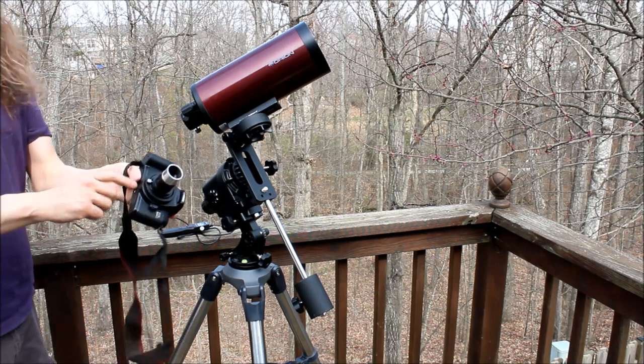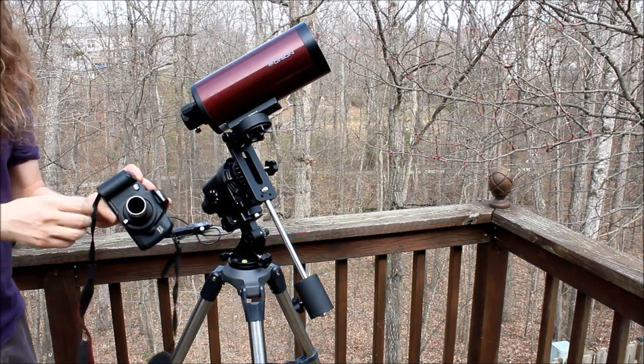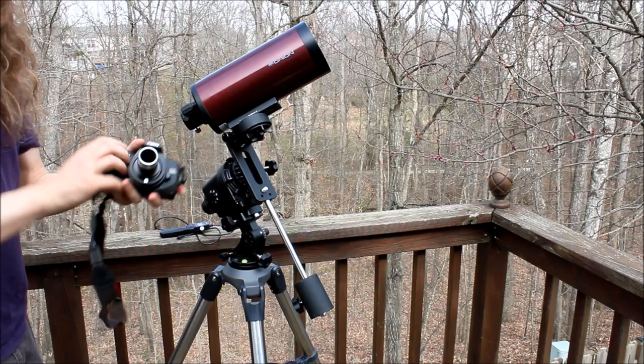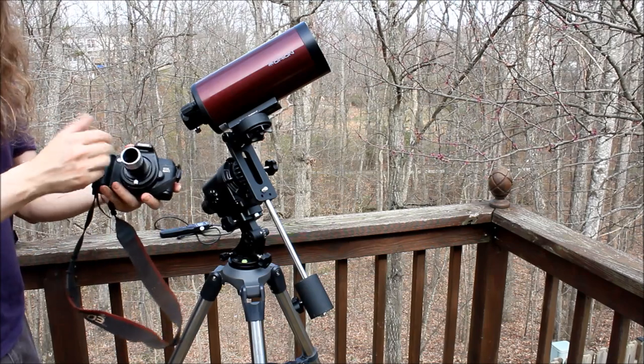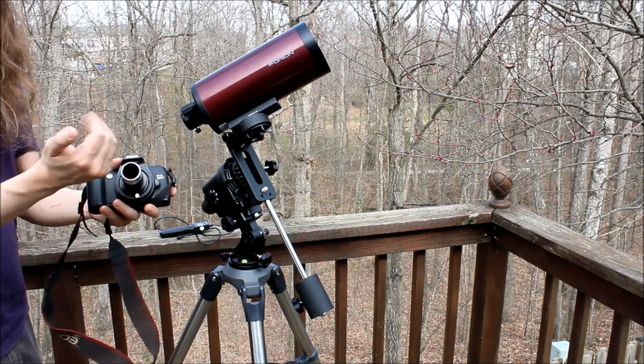And that's the chip that's inside, and what you end up with is these little specks that appear all over the photograph. If you have those, that's where that's coming from. Usually most cameras, when you go into them, have a manual clean button that opens up the shutter and lets you see what's inside, and you very carefully blow that stuff off. Don't touch it with your fingers. Just blow it off with the little duster.